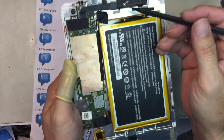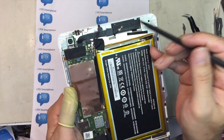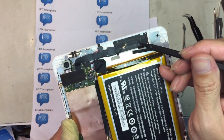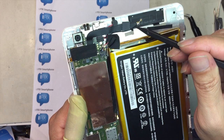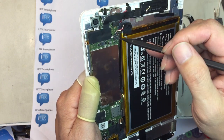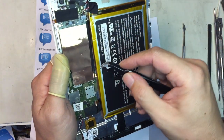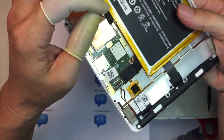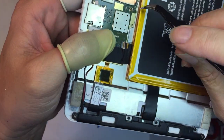And then here's a Wi-Fi antenna, just like any antenna here. You try to catch all the GPS and the Wi-Fi signal, and the antenna says GPS, Wi-Fi. So you know this is a Wi-Fi antenna here, and then there's a cable. If you follow this along here, this has to be connected to the logic board. Okay, there it is. Right now, it's cut. Actually, it's not cut, it's popped out. And it didn't pop out, actually, the connector is broken off from the logic board.